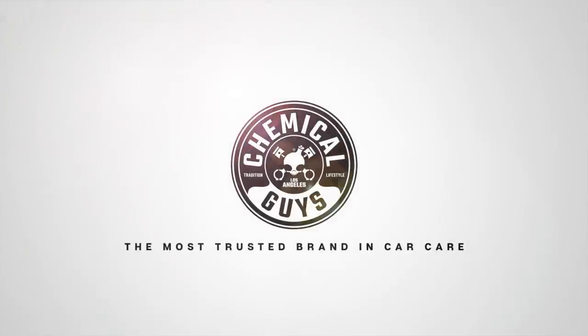Today I'm going to be showing you guys how to enhance your beautiful paint job with this metallic flake to get it looking as best as possible. Before we hop into the rest of this video, I want to mention that I have already washed this vehicle and we have already clayed it. We washed it with Clean Slate, which is a surface cleansing wash that pretty much removes any kind of waxes and previous coats of sealants that you've applied to the paint. We do that to remove any oils and films that could potentially interfere with the results.